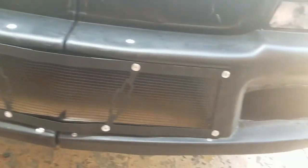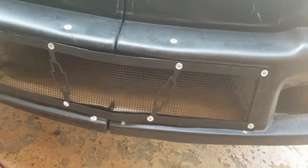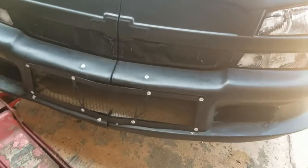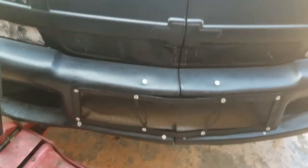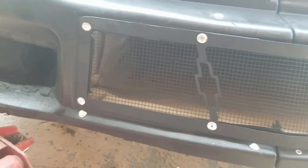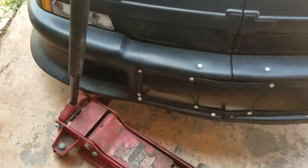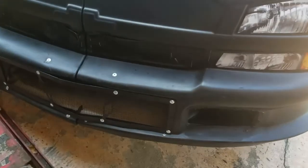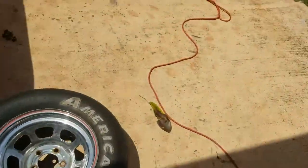I went and took the front shroud off. Took it off, cleaned it up, painted it, re-riveted it with bigger rivets. 3/16 racing rivets instead of them other little small ones that'll pull out again. It's going to be as straight as possible considering the nose is a little bent up on it. I straightened out a little bit of the radiator cowling there, because before it was all pushed up, I was losing about 2 inches of cowl coming in there. But other than that, just straightening up, going through things. Go look underneath, and then got the tires pulled off.